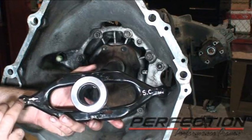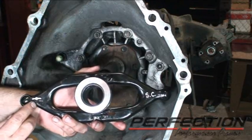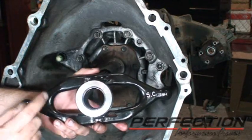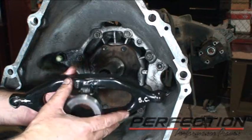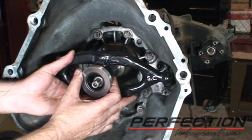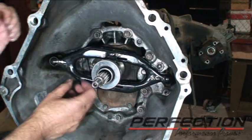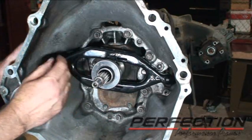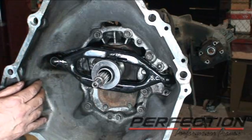The clutch release fork. There's a slave cylinder end and a ball stud end. The ball stud end on this Jeep, and probably the Dakotas, is marked with a part number over here. Now I compared this to the old fork before I removed the retainer, so I got that right. Now this bearing is a non-metallic collar. There's a small amount of grease applied on there, and it just slides on. Then I'll seat the clip. But this would be the basic setup to put the fork and bearing on.